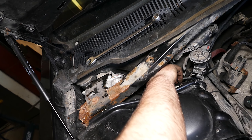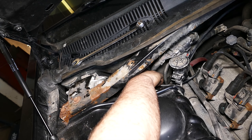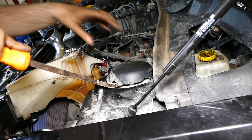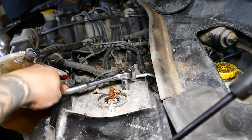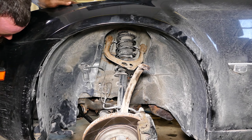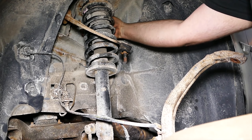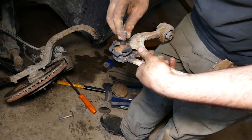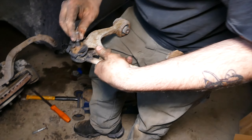You'll eventually get the 18mm nuts off with the 18mm box combination wrenches. After that, let's pop the strut cover off and remove the three 13mm retaining nuts holding the strut — we will need it loose to maneuver the strut away from the upper control arm bolts to get them out. We'll use a crowbar to help move the strut around. With the upper control arm nuts off and the strut loose, let's go ahead and slide the upper control arm bolts out. Once these bolts are out, simply remove the upper control arm — that baby really needed to be replaced bad.